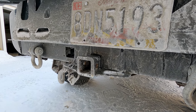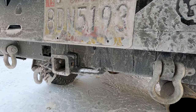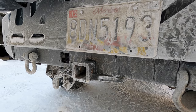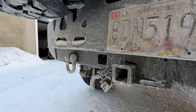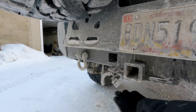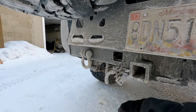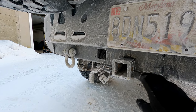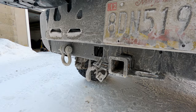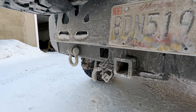So far this bumper has been pretty solid. I do wish it had mounting options for jerry cans, water jugs, and gas tanks, but overall it's a pretty solid rear bumper. It does come with a hitch — when I did my initial towing I had to widen the pin hole slightly with a drill. It comes with recovery points and I put some D-rings on there. My car came with a four-pin harness that I have zip-tied up so it doesn't hang too low.